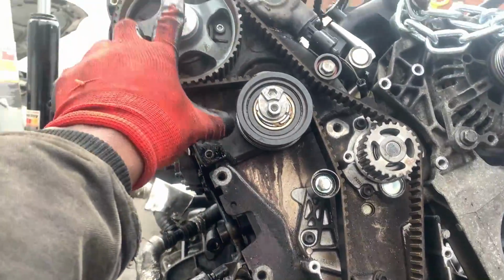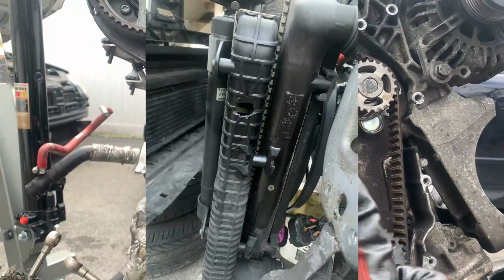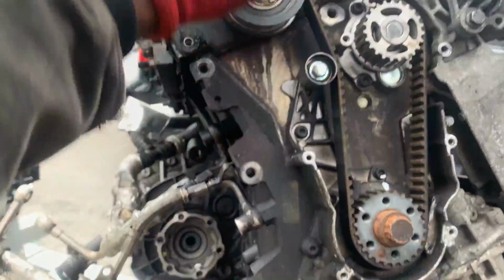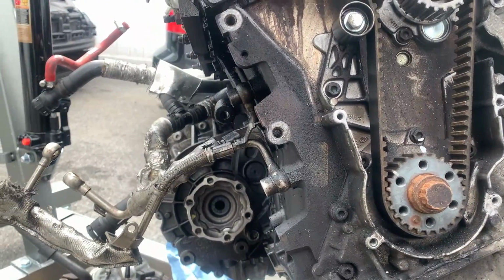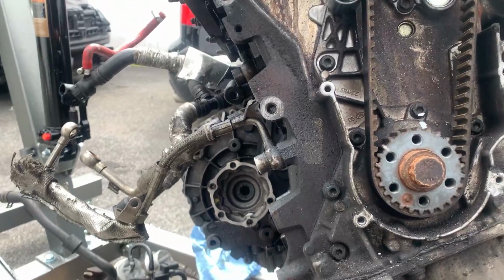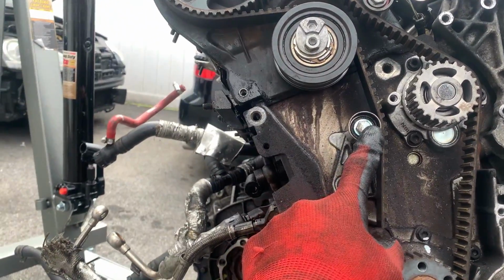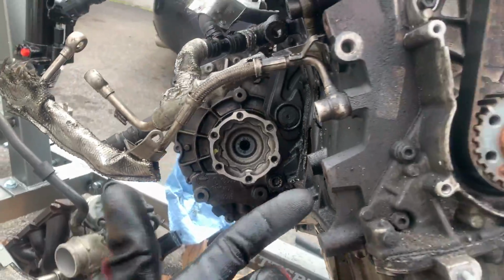Customer was complaining that the car was down on boost. So we fixed the intercooler. The intercooler had a boost leak, a big hole in it. Then we replaced the water pump, and the car stopped overheating. The car was pulling like crazy. The guy wanted to get the car retuned, went to the dyno, and I think the tuner turned the boost up too much. After picking it up from the tuner, the car broke down. They shot a piston rod through the block.